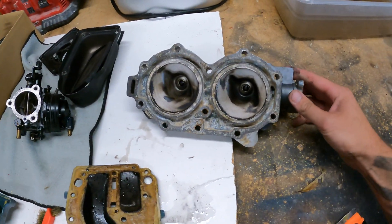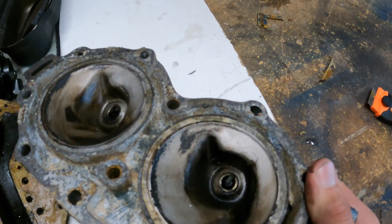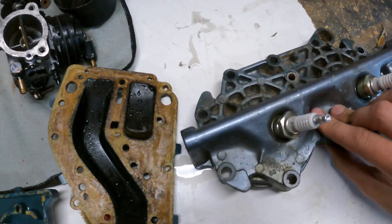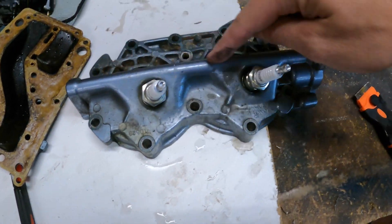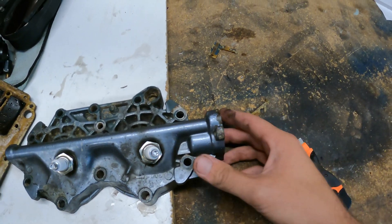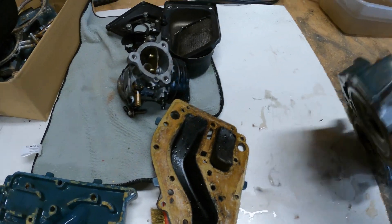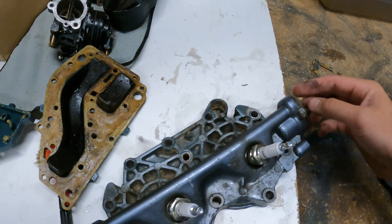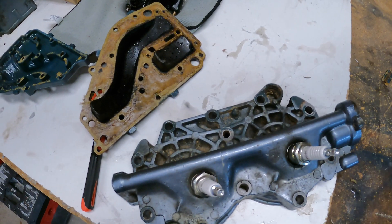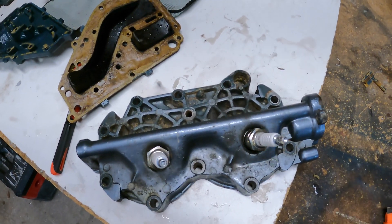Here's the head. I don't even think it's worth replacing the old one - if you look, you can see where it's chipped and it's got some scoring. Water comes in here and exits through here, going around - there's probably a ton of corrosion inside, and I stuck all sorts of stuff down in there but it's just so corroded I can't even see what's in there. So I went ahead and bought one off eBay for $35 - it was from a freshwater ski, looked really clean - so we're just going to replace the whole head because it's not worth it at that point.